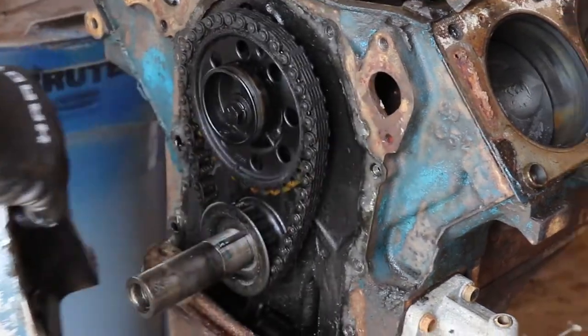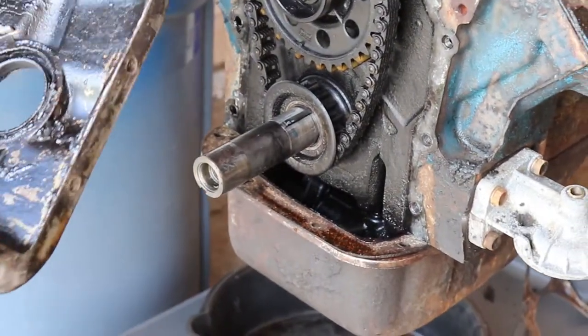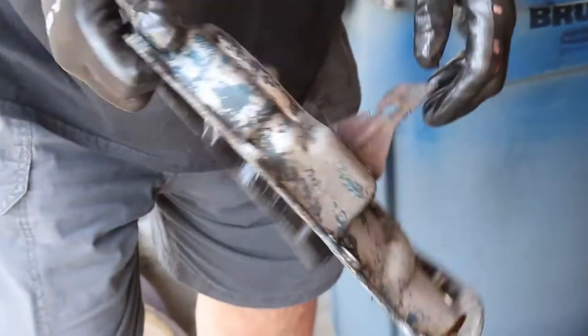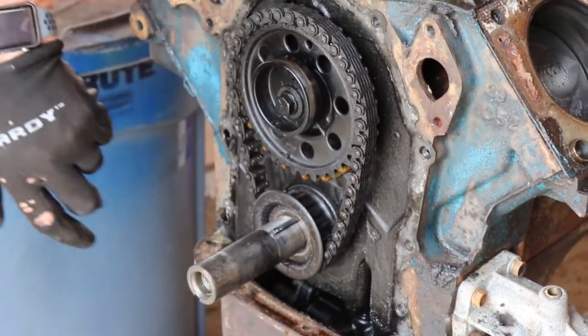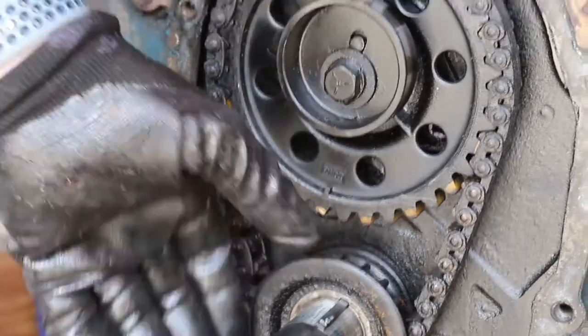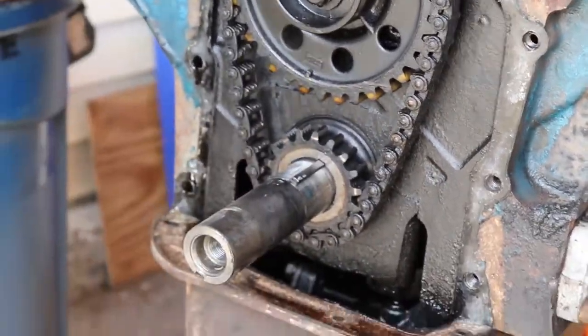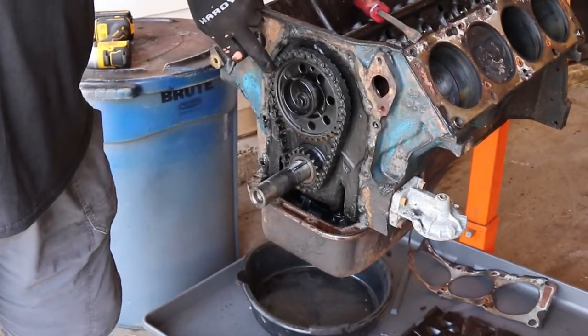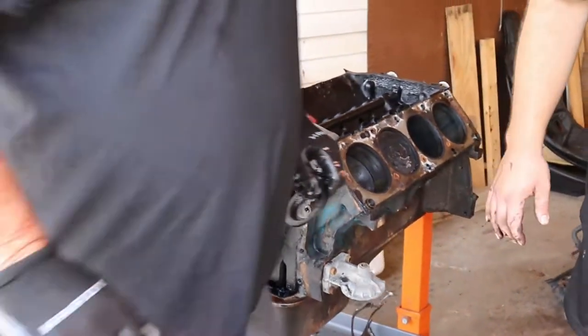That's a big old timing chain. Look at that — the gaskets are still good. It's pretty clean. How sloppy is it? That's pretty sloppy. It's got the original plastic gear. They came with a plastic gear? Oh yeah. The reason they put plastic is to make it quiet — so you wouldn't hear it. This was a luxury car motor out of a Mercury Marauder, so it had to be quiet. They used nylon — it's actually nylon.